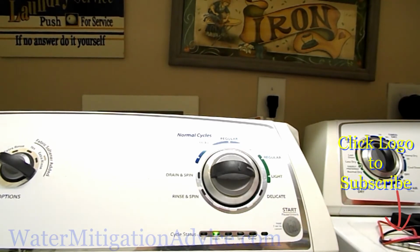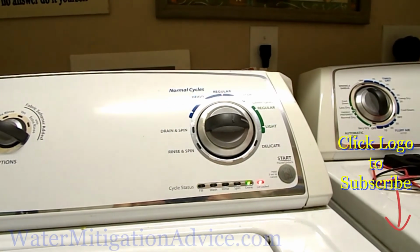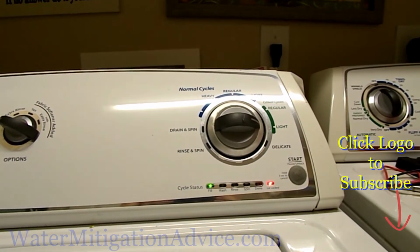When it does, gradually move it to the right, one click at a time, and you'll see the lights on the bottom light up. Keep going until the rinse light lights up. Once the rinse light lights up, then you want to hit the start button, and it's going to start making noise and doing all kinds of wacky stuff.